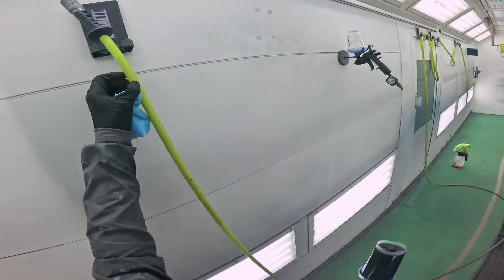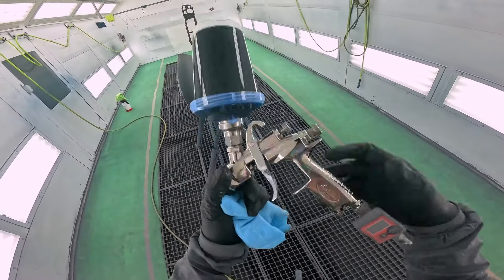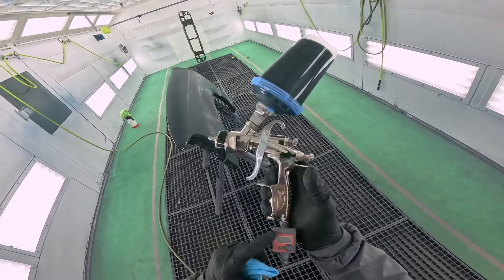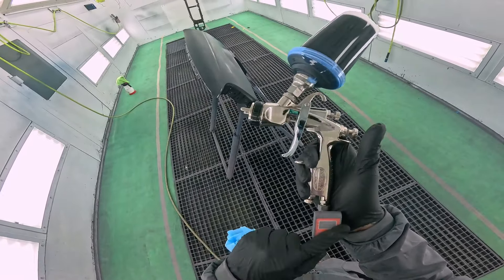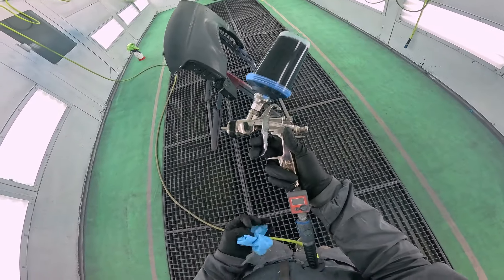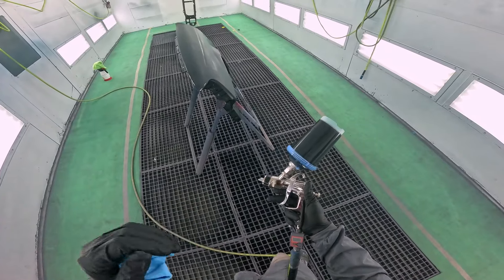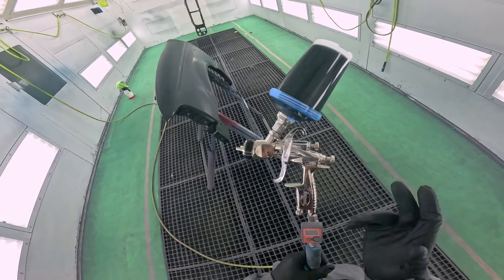So I've got a little bit of sealer mixed up. We're going to do this DIY style. I'm going to use the Eastwood Elite CC500 — this is an HVLP gun, but it also operates pretty well with smaller air compressors. I do have my DeVilbiss digital gauge. If you guys are going to do a lot of painting, these DeVilbiss Digitals are by far the easiest gauge to use, because if you find a pressure that sprays a certain product exactly how you want it, it's easy to replicate versus an analog gauge that can sometimes vary and isn't super consistent.